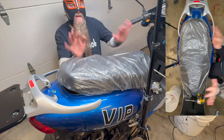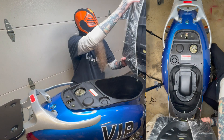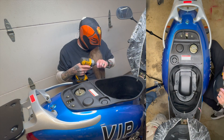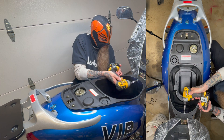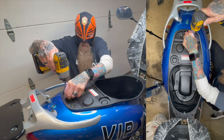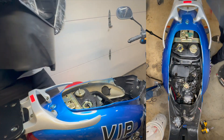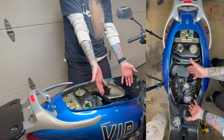All right, people. This is going to be the easy part. We're going to pull the seat and the whole cowl assembly off. All you do is raise up the seat, and as you can see, there's a couple 10 millimeter nuts down there on the bottom. We'll take those off, then we got a couple of 5 millimeter Allens on there, and then two up here. The whole seat and assembly comes right up, which will now expose your carburetor.